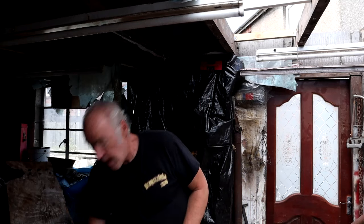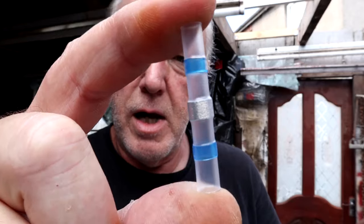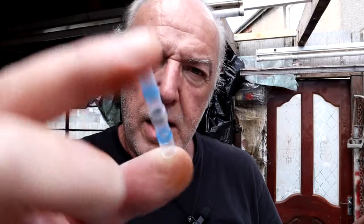However, I did manage to find online — I actually saw it on YouTube — you can get these. These are supposedly a wonderful invention. They're from a company called Solder Seal. They come in various sizes. All they are is a bit of shrink wrap. Those two blue bits you can see on there — apart from the colour coding — they're actually waterproof sealant as well, and the solder bit in the middle is solder. The idea is you slide this over one of the wires, twist the wires together, pull it over the top of the bare wire, and then heat it up with the heat gun. That melts the solder and creates a watertight seal that's permanent and should fix everything. It's supposed to be a lot easier than using the old way with the soldering gun or the butt connectors.